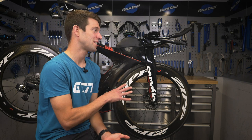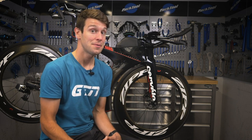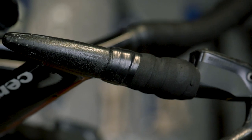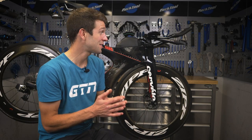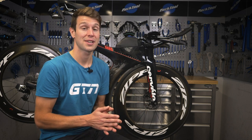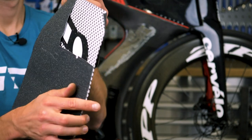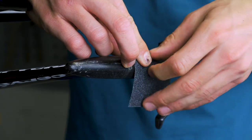For this next one I have switched bikes, as I'm now going to be focusing on the bar tape. When we're using a TT and triathlon bike, we're going to be in the aero bars for most of it, with a lot of our weight going through our elbows, not so much on the end of the bars, particularly the base bars. So do we really need bar tape that is potentially causing a disturbance of the air as it flows over the bars? I don't really think so. Some athletes actually opt to completely remove it and leave the bars completely bare. However, given that we are doing triathlons and going from a swim to the bike, we're going to have wet hands and want a little bit of grip, particularly if racing in wet conditions. That's where something like this grip tape comes in — skateboard grip tape. It's grippy on one side like sandpaper, and on the other side we've got an adhesive. So we can simply cut this to size, wrap it around the handlebars, and there we go.